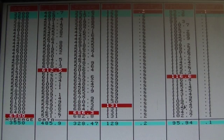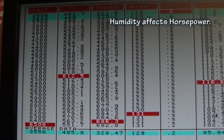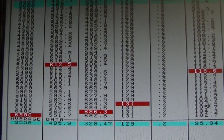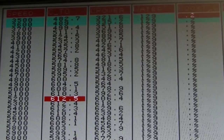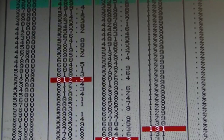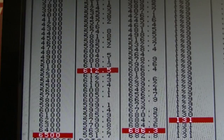Alright, so here is one of the dyno pulls. It was raining, so the numbers are a little off here. But at any rate, 686 horsepower at 6400, 612 foot-pounds. When you start looking at the torque — 511 pounds at 3800, then 535, 557, 589, 600, 612, 612, 610, 608, 590, 551 — it just hangs that fat torque. That little band from 551 to 511, it just hangs torque for a long time.